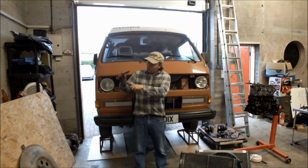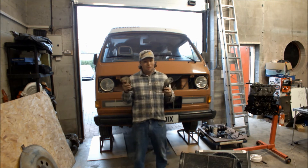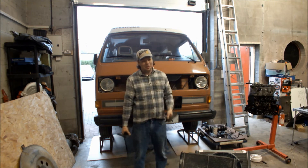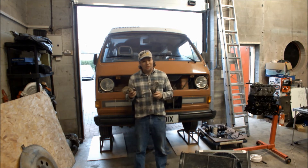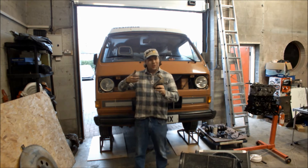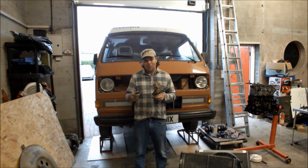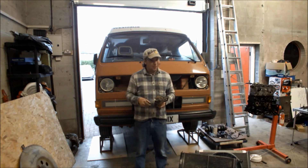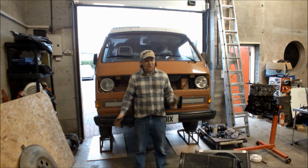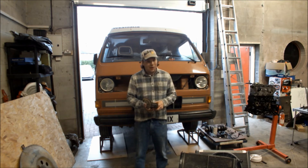The other thing — where the bolts actually go through there, they were nutted and bolted and you had to get your fingers behind the hole to get a spanner in. That was a pain. So I've actually got a big industrial rivet nut gun — not one of these lazy tong things from the hardware shop, it's a proper one like they use for aircraft. It goes bang and it really puts them in. So I'm going to put four of those in. This time it was easy, it came apart — the next time I might not be so lucky. So I'm going to do that while it's out.